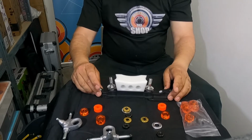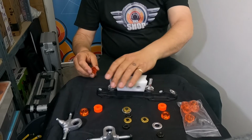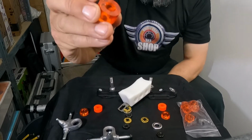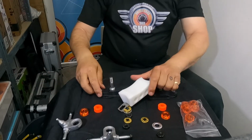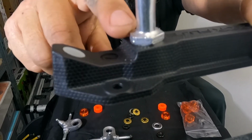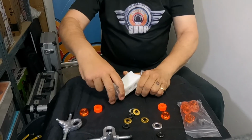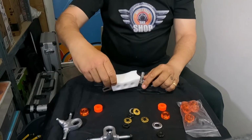Disco block on first, okay, put the rings on. Now normally if you weren't fitting a disco block, I'll show you this. There's a little bevel in some of the cushions, right? That is ideal because, as you can see in some of the plates, there's a little bevel in the kingpin, right? So that's ideal. So I would always put that little bevel down the way, right?